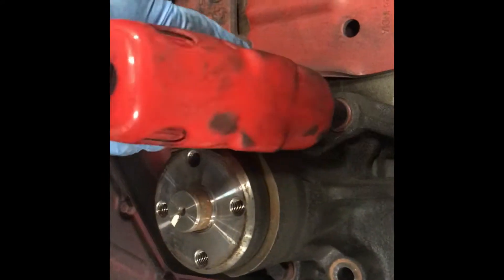Let's see if this gun can take it. Very good — y'all just took out the alternator bracket. I just wanted to show y'all something that I do. I keep reading from my light, hopefully y'all can see. Whenever I take a bolt out or anything like that, I like to put them back exactly where I got them and put a zip tie on it, that way I know exactly where it went. I don't gotta worry about guessing where bolts go.